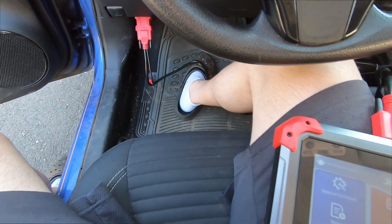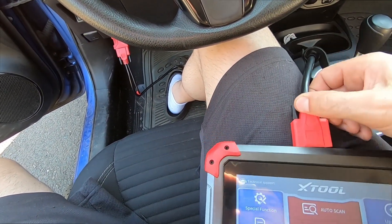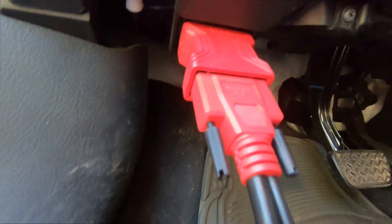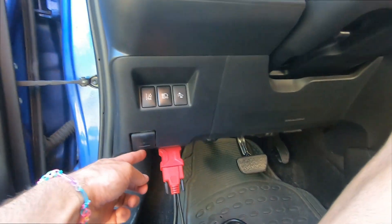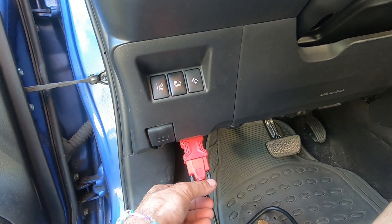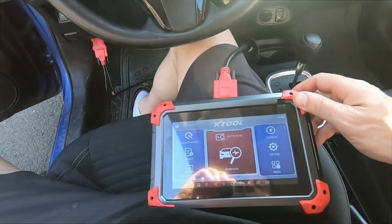To get to the bottom of this I have my scan tool, with the cable that plugs into the scan tool on this end and then into the OBD2 port, which is just above and to the left of the brake pedal, underneath the dash right there. In this vehicle it's actually a white connector and you just shove your OBD2 cable on there and away we go.